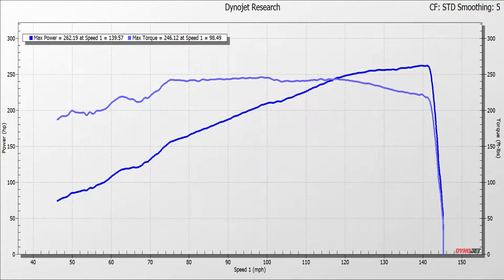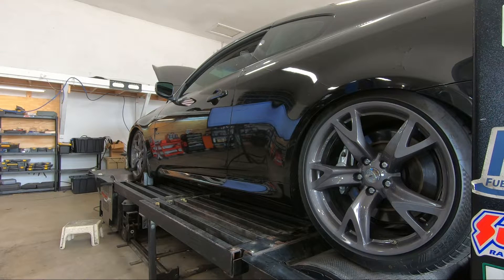So this is our baseline. As expected, the car is running lean with the hardware changes and no real tune, so we're going to correct that first. I corrected the MAF using long-term fuel trims and added some fuel past the 3000 RPM mark.